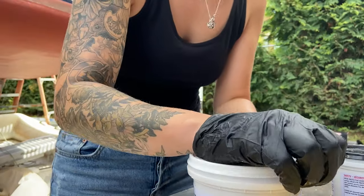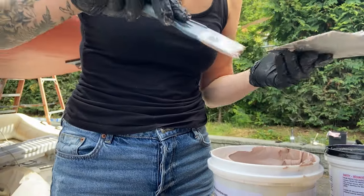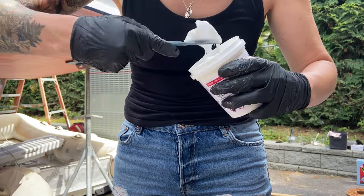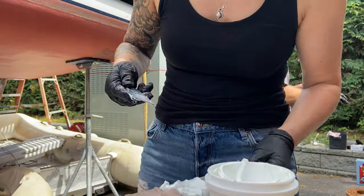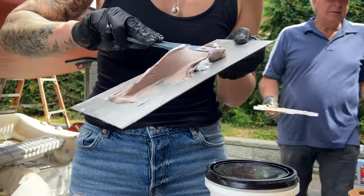He's crazy! We've got all the blisters wetted out with epoxy. Time to break for some lunch, let it set a bit. You want to apply the fairing compound when it's just a little bit tacky. Now the reason we picked System 3 Silver Tip epoxy is that it can be recoated straight over previously epoxied areas within 72 hours without any need to sand or wash out the patch. It's now been 48 hours, so we'll be able to epoxy straight over those patches from Saturday and the epoxy will adhere. Then the fairing compound will be able to adhere straight to the epoxy after that.